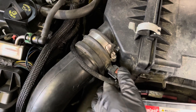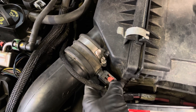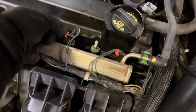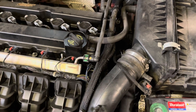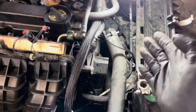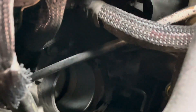Take this sensor off — most of these little sensors have a sliding lock tab, so you slide it back and then you can remove it. Same thing goes for the fuel injectors; these ones just slide up and down. Go ahead and take out all the wiring up here, set it aside, take this tube out because you want access to the throttle body down there. At this point we have removed the front half of the air box and the intake snorkel going down to the throttle body. You can see it has some gunk in there — quarter million miles worth of built-up oil. Get that cleaned out and I'm sure this thing will run amazing afterwards.